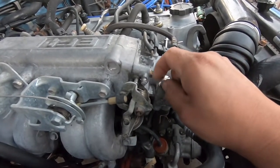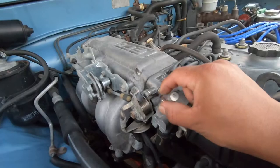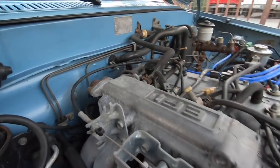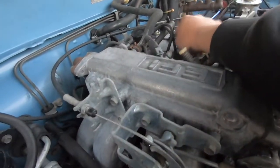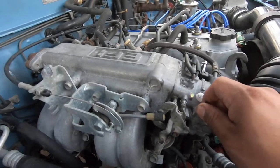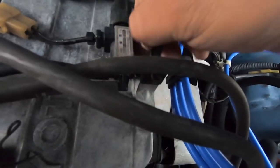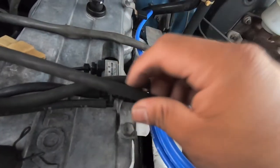You can see if we close it all the way it cuts off. I turned it back on and backed it off — it still has a little misfire, so we're going to try to figure that out. We're going to replace all these vacuum lines right here, hopefully preventing any vacuum leaks. There's also a clicking tapping noise up here — we just did the valve adjustments and I guess it's not right, because it started clicking loud. I'm going to redo that. If anyone could leave a comment on what this component does or its part number, and whether we can just remove it, that'd be great.